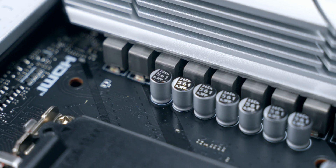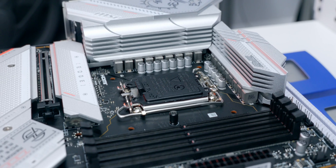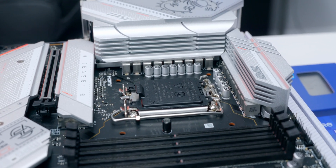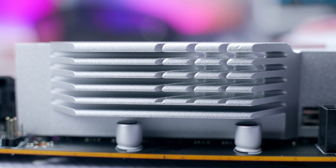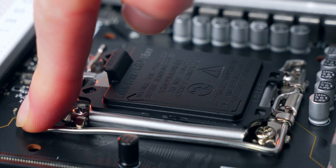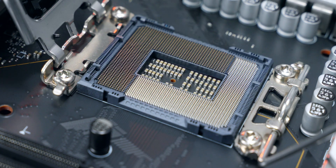There's a 16+1+1 phase VRM power design. The MOSFETs sit under a set of two big heat sinks joined together by a direct-touch heat pipe, and there are thermal pads over the chokes to help keep those cool as well. The cooling system on here is pretty beefy and should do a good job keeping the power circuitry running cool, which is important for stability and longevity on higher-end systems. Even with all those big heat sinks, there still seems to be decent space around the socket.